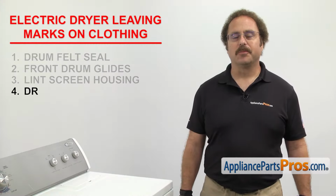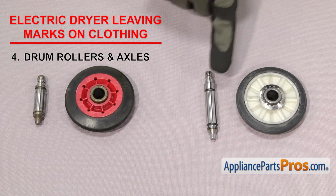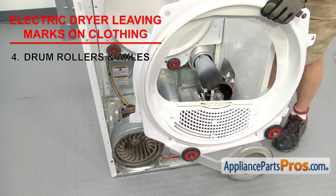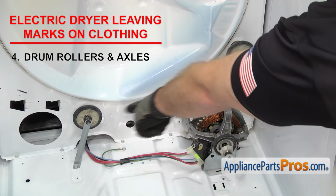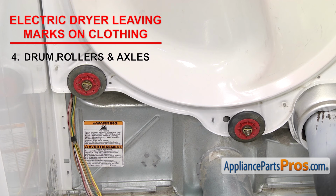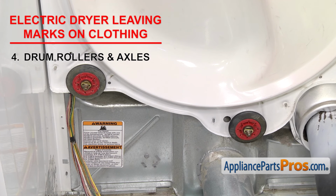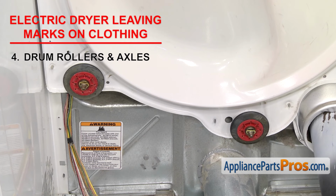Next on the list are the drum rollers and axles. The drum rollers and axles support the drum as it turns. The rollers have bearings in them that ride on the axles. Depending upon your style, you might have 2 in the back and 2 in the front, or just 2 in the back. If your clothes are getting marks on them, it could be a sign that the bearings have completely failed and the drum is bouncing up and down as it turns. When this happens, the clothes can get pinched between the drum and the bulkhead.